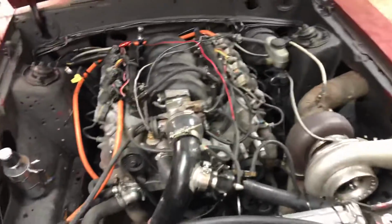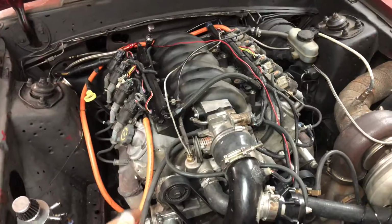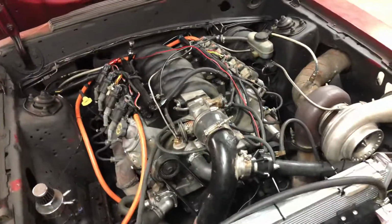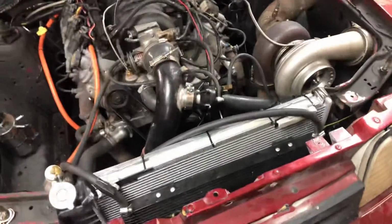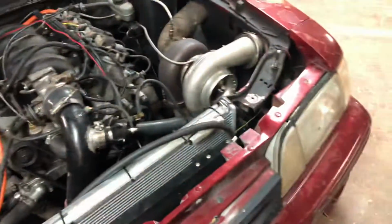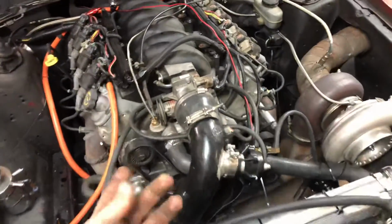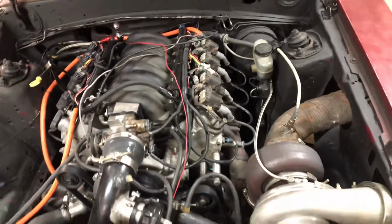So we're just trying to get a handle on it. I don't know where to go next. I don't know if the water pump is bad. It's the only thing I haven't replaced, the damn water pump. It's circulating water, I think. We just temped the radiator and we temped the water pump. The radiator was at 190-ish degrees, right? Yeah, all over the radiator it was 190 degrees, and then the water pump itself was like 210. Closer to the block it was around 215.